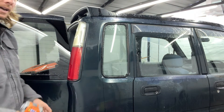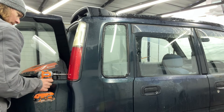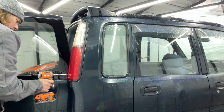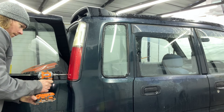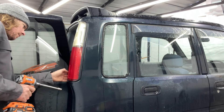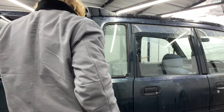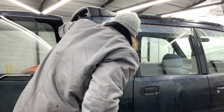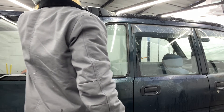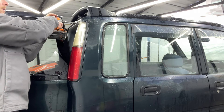You're going to have to open up the hatch to get to the bolt here — open it up all the way. That's going to let you get that 10 millimeter bolt out of there. Set that aside, and then your other 10 millimeter is up on top.